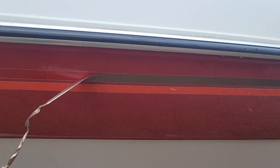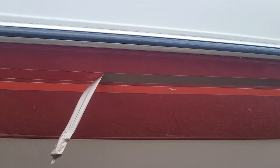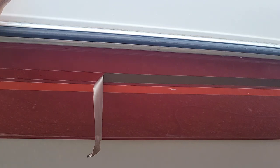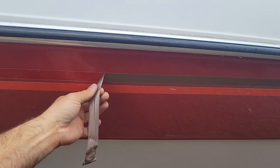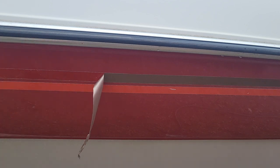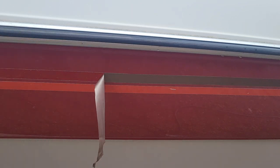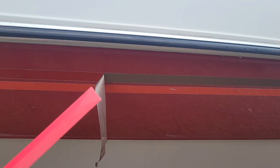So you get the idea of what I'm doing here. I'm going to pause — I think it's got to be close to 8:30, 9 o'clock in the morning. I'm going to see how far I can get and how long it takes me to take this side of the boat down. Really, this is the way to do it. I've watched videos on those decal strippers, power washing, abrasives — a heat gun on the low setting with a little bit of heat to get started, just watching the decal. If it gets too stretchy, it's too hot. If it's sticking, it's not enough heat. It's going quick — what took me five minutes over there has taken me five minutes for the rest. When you rip it, that's when it's a pain to get started. These plastic chisels from Harbor Freight are great at getting it started.